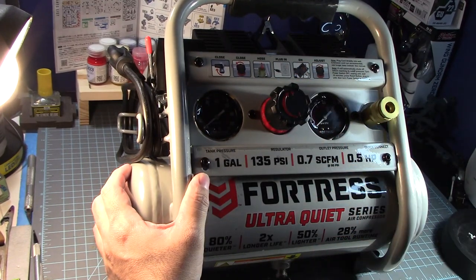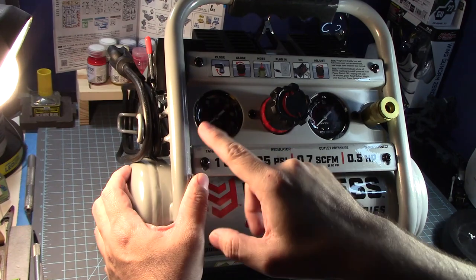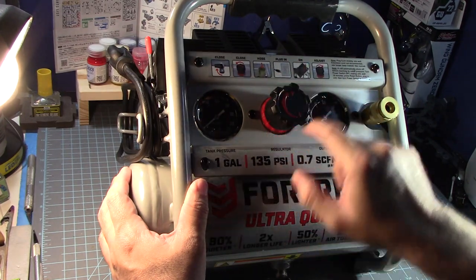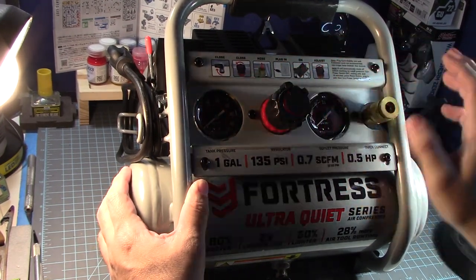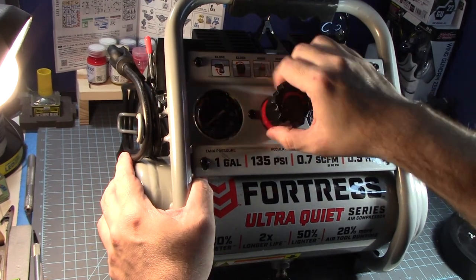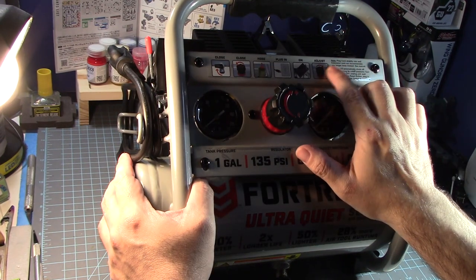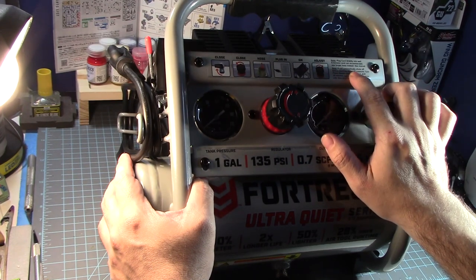This supposedly allows you to control the PSI. This is where it tells you how far the tank fills up. Based on what I saw in the video — when it turns on, this fills up, and once it reaches full it stops, and then you're feeding off the tank itself. There's a connector here — note: plug the cord directly into the wall; extension cord is not recommended. If the unit shuts off before reaching cutoff pressure, turn off the power switch, unplug, wait 10 minutes, press the reset button, then turn on the switch.